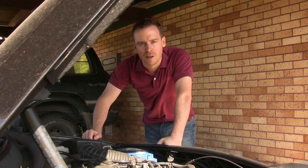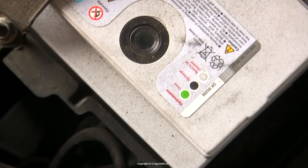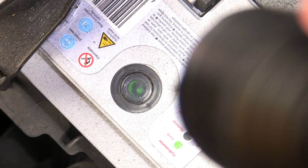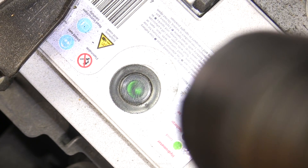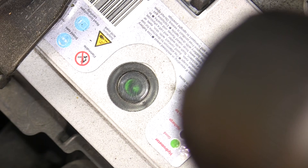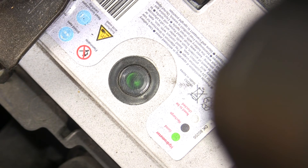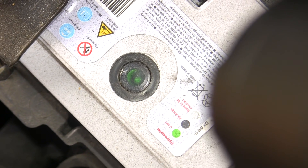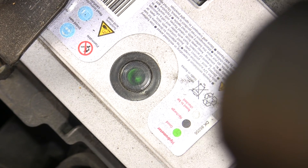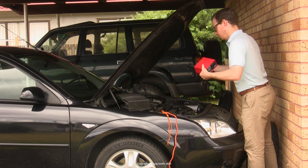Apart from the voltage, with a sealed battery the only other thing you can look at is the inbuilt hydrometer. In the old days with unsealed batteries you could check each cell and top up its water. But basically all batteries now are maintenance-free types and you can't access individual cells, at least not without cutting the tops off. So they give you this hydrometer which is a measure of the cell's chemistry, but there's only one.